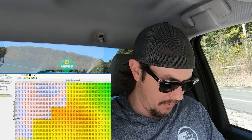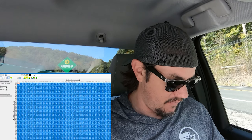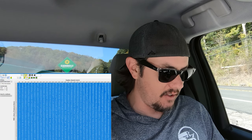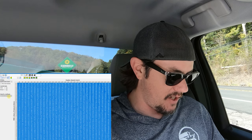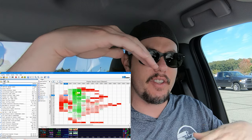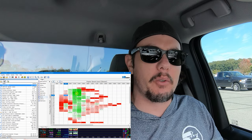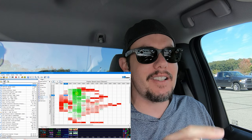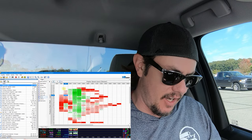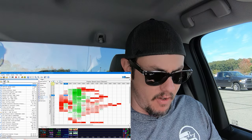Okay, let's calculate and see what we come up with — shouldn't be too bad. We're going to go ahead and copy this over to the manifold switch close just to be safe. This is not really necessary, but it makes sure that if for some reason your tune is working on one of the other ones, it'll work properly. I'm going to go ahead and flash this in and keep on driving — I'll catch back up with you then. Okay, we're looking a little better down here. We've got a couple of lean spots still, a couple of rich spots. That is whenever we calculate the equation taking our values — it's like fifth-order polynomial math, and because of that, to calculate the curves to build the map, it has to adjust values automatically. It causes us frustrations as tuners on these virtual ones.